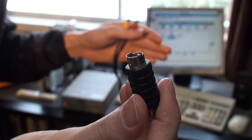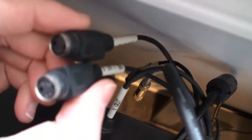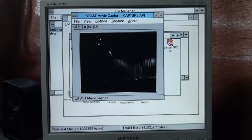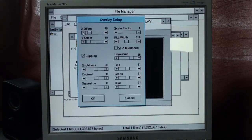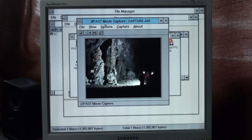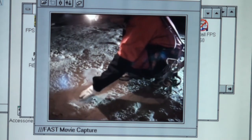I'm also going to use a mini DIN-to-RCA adapter to use the composite video input. As soon as I click play, an image will appear in the box. However, it will require some setting adjustments, such as selecting composite video and making it fit in the right position. As you can see, the overlay is not well-adjusted. This configuration depends on screen resolution and only needs to be done once. When completed, we can see the image perfectly aligned inside the box. The quality of the video is quite good — it plays smoothly and I can't see any glitches, despite it not being the full video resolution.